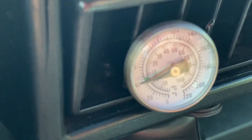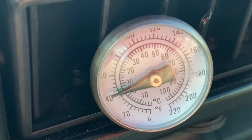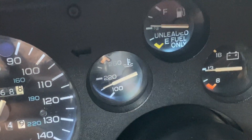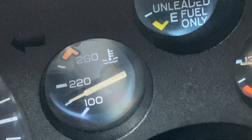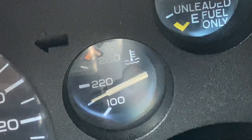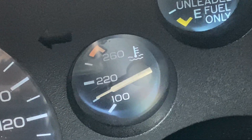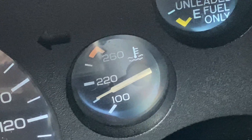I did a lot of work with the AC, actually, for the past year and a half. For some of you guys that follow me, getting the best AC I can out of this car has been a focus area of mine. After driving it — now it's been probably 50 minutes or so — that's as hot as this thing has gotten, and I just pulled in and it's actually coming down a little bit. I'm getting ready to pop the hood just to see if my painter's tape, cardboard, and duct tape for that front shroud — which is really just my mock-up — is still intact. If that seems to work, I'll see if I can get a buddy to help me fabricate that out of metal or some ABS, and create something that's removable. The AC is colder than ever — I literally had to turn it down to normal and the fan down to the first notch, and it's a really hot day today.